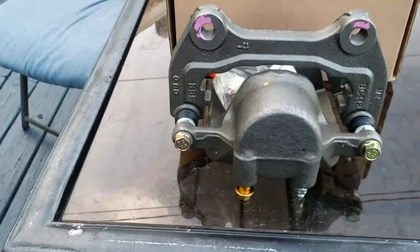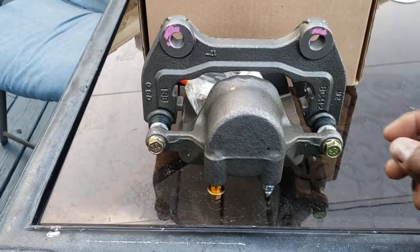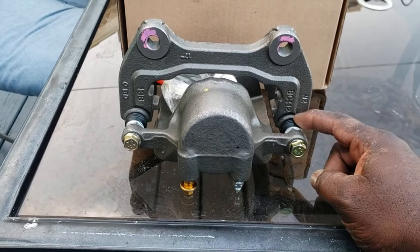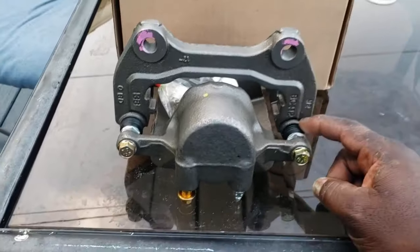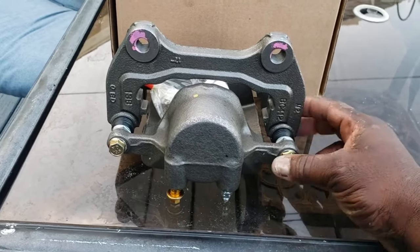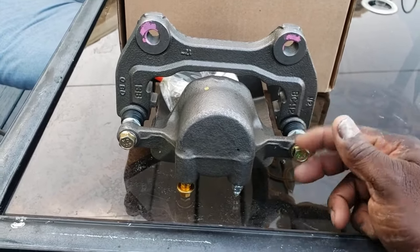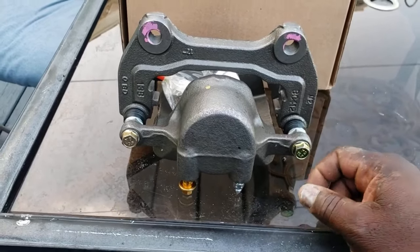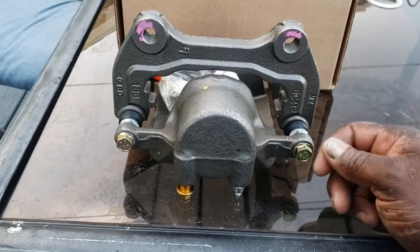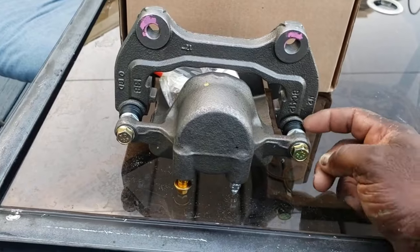And the reason why I'm changing the brake calipers, I just changed the brakes about 2 weeks ago, but I noticed that the floating pins that I replaced in another one of my videos, go to my channel and you'll find it, less than a year later, those pins were frozen. I couldn't get them to go back in. So I took a hammer and a chisel and I knocked it in, and it kind of moved back and forth. So I pulled the pin out and put some more grease on it. Then I put it back in.